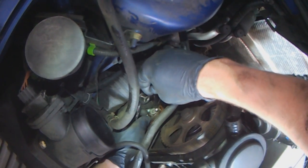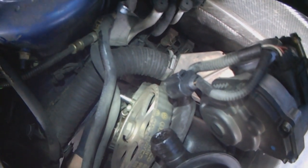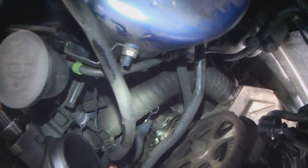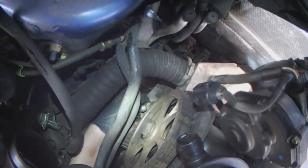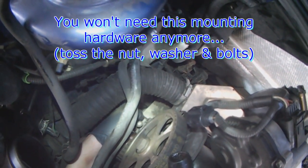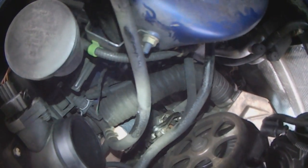Make sure to catch any washers - you don't want them sitting on top of the crank sprocket and coming off when you start the engine. Two 10mm bolts for the hydraulic tensioner, one at the top and one at the bottom. Once they're loose you can just use your fingers. Since we're not going to install the hydraulic tensioner, you can get rid of those bolts. Same with this tensioner nut and washer - we're not going to need those because we're converting to the old style, and the old style uses a big stud, not a little one.